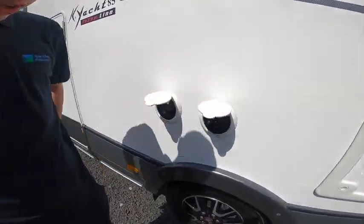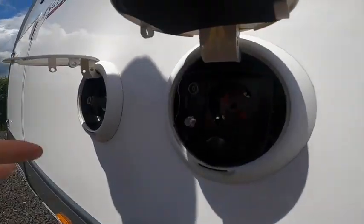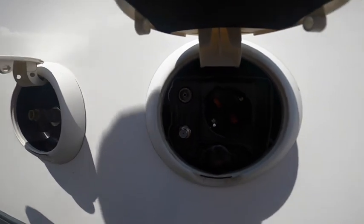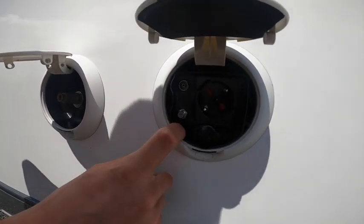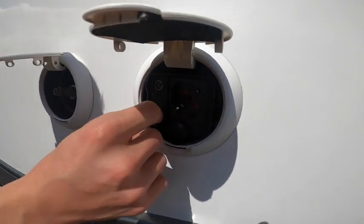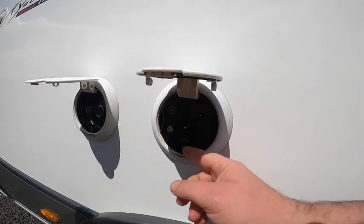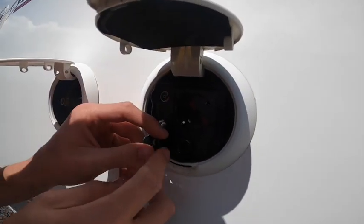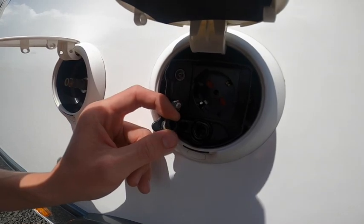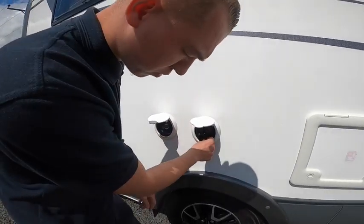Here you have your external TV points. For a super site you can use their aerial by connecting it to the vehicle — you'll need to carry a length of coax, or you can use the F-type connector, which is more of a satellite connector. You've also got a continental plug, so you'll need the adapter, and an old-style 12-volt point which also requires an adapter to get 12 volts here.